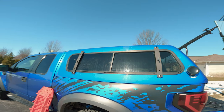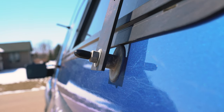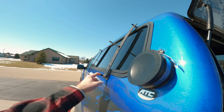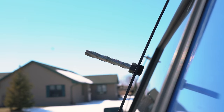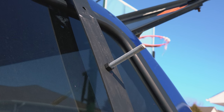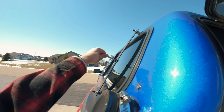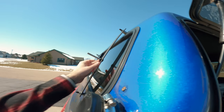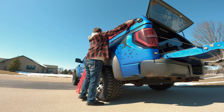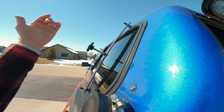That's what it looks like when the boards are off, to give you a better idea of how this is attached. You get your fender washer, a spacer, another washer on one side, another washer on the opposite side, and then the nut — same thing top and bottom. These are longer eye bolts, and this bolt is a three-and-a-half or four-inch bolt. Depending on the size and thickness of your traction boards, you'll need the appropriate size. There's a hole drilled in there, it slides through, and then it's bolted on so it's not going anywhere. The traction boards just slide onto there using either the existing holes, or in my case I drilled some holes, and these knobs — also available at your local hardware store — go on there and tighten down so they're not going anywhere.